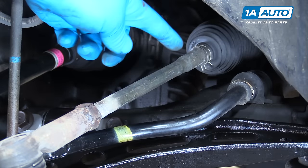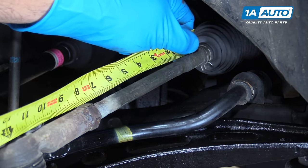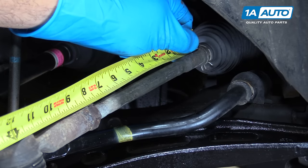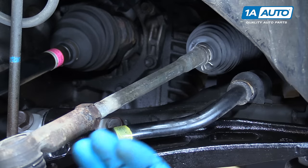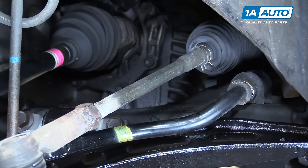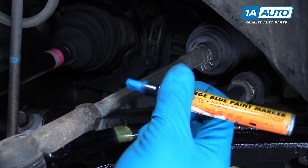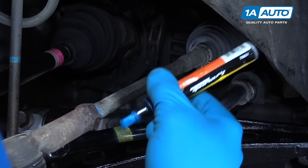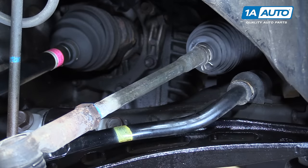Using a measuring tape at a fixed point like the end of our bellows, we'll bump the end of the measuring tape there and measure to the end of our lock nut, which is about eight inches. This way, when we install our new lock nut at eight inches, we'll know that this total distance and angle is going to be roughly the same. Another method you can use is taking a paint marker. While a little less precise, you can mark a line on the threads at the back of the lock nut, and butt the new lock nut to the edge of the mark we've made.